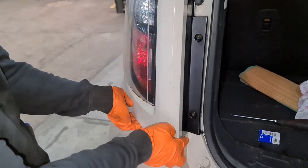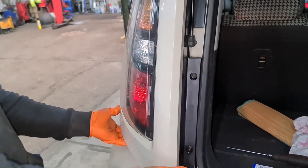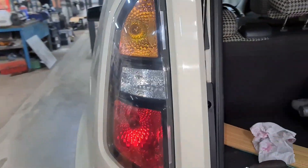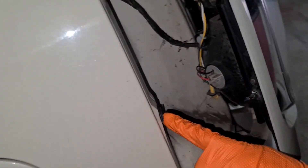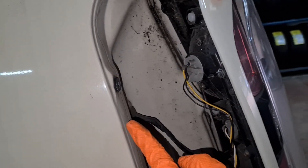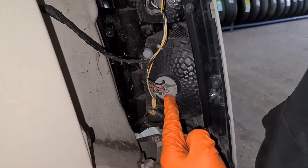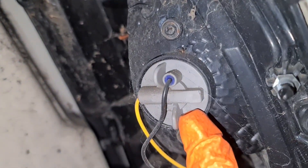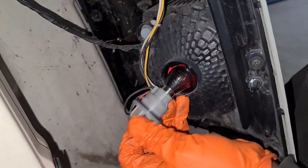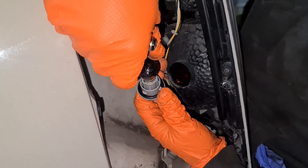What I do is slightly wedge my hands in and then pull the light up towards me. If you come around on this side, I'm just going to show you something — if you look in there, these are the little lugs that go into this little hole, that's where they get really tight. The bulb we're replacing is the bottom one, which is a brake light and the position lamp. This one's a reverse lamp and that one's the direction indicator.